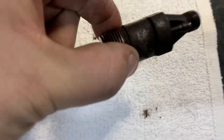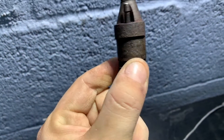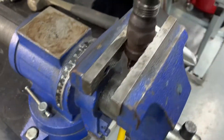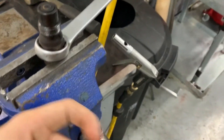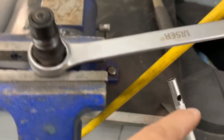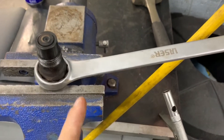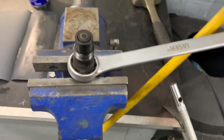You're going to need to put it real tight on the upper part of the injector where there's a flat — right here, as you can see. Put that in your vise, make sure she's nice and tight. Get yourself a 27mm, put it on there, and make sure it's going 90 degrees to your vise. If you put it off to the side, you're going to be pushing the injector down and it'll just keep falling. This way, when you're fighting it, it's going directly against the center of your vise.